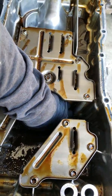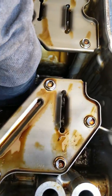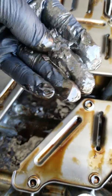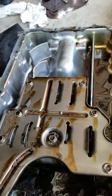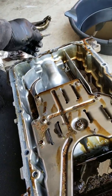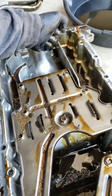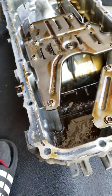I'm actually going to put it back together anyway, because I already bought the bearings. I'm not going to send them back — they're like 50 bucks. I'm going to put the motor back together and try to clean this thing out as good as possible. That is nasty. You can tell some of the bearing just wore out and got really thin. The forum says these particular motors have an issue where the oil pan is really deep and it's not getting sufficient enough oil. If the manual calls for six quarts, you might as well put seven quarts — overfill it a little bit. Or you can modify it and find a shallower oil pan, maybe that'll help. I don't have the time or money for all that, so I'll try to get on this thing when I can.